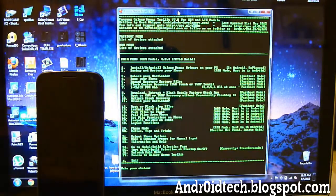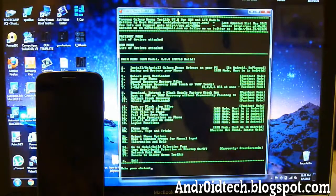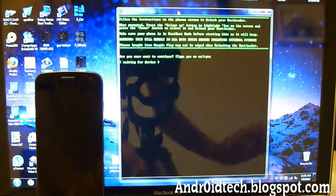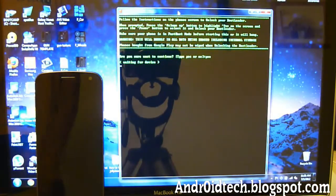I'm going to be choosing option 5 and pressing Enter. Now it gives me all these options. Before we install Clockwork Mod Recovery onto our phone, we have to unlock the bootloader. So first, unlock your bootloader by selecting option 3 and pressing Enter. It says 'Are you sure you want to do it?' — select Yes. It says 'Waiting for device,' which means we're going to first enter into bootloader mode.